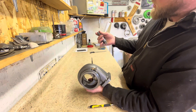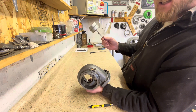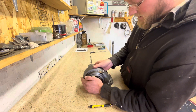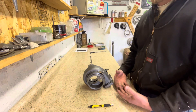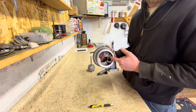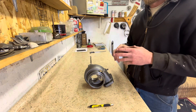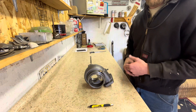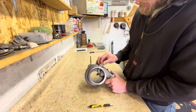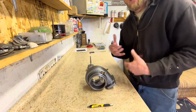The spring gate is tough to set up because you don't know exactly what your PSI is as you tighten the turnbuckle down. Versus the canister gate, where I can set it at exactly what I want. When you're making a lot of boost in an S3 or S4 compound setup, we'll often do a spring gate. Normal singles are just a canister gate. On race setups where the wastegate is on the manifold, those are spring and air — often with regulators — and much bigger gates than what you'd see on an OEM-style turbo. Those are for engines building gobs of power, lots of nitrous, a really violent hit. We're trying to keep the setup where we're not chucking turbos, drive pressure going crazy, or popping head gaskets. That is how your wastegate works. Your 30 PSI wastegate setting is simply when the puck comes off the seat — that is not wide open. That is the point where we start to regulate drive pressures and shaft speed.